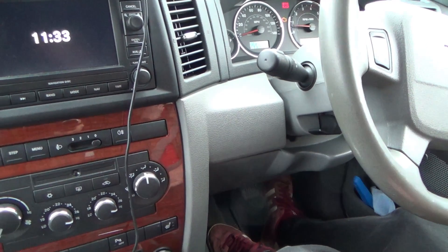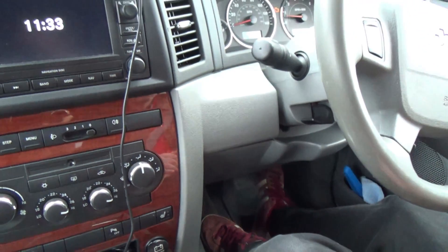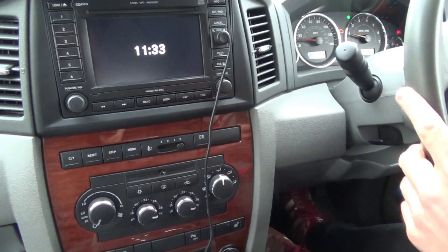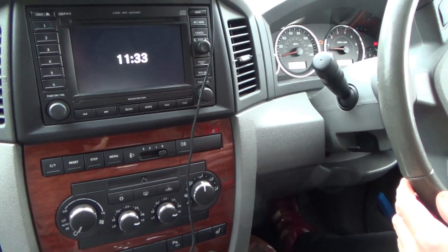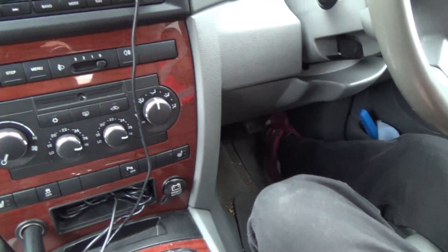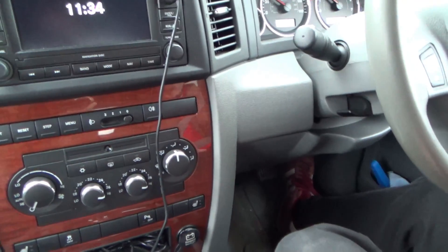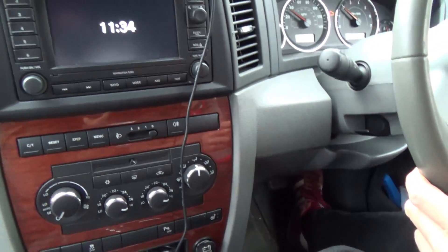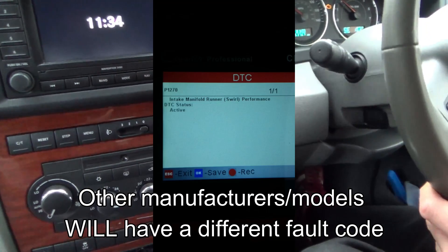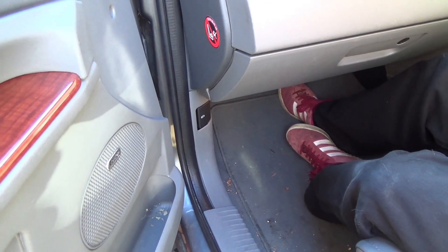This is my brother's car - he's going to drive it now and we're going to do a kickdown. You can see him putting his foot on the accelerator and the car won't kick down. It's limited to 3,000 revs where it stops. It's a 3 litre V6 and it's just lacking power. When we plugged in the diagnostic tester it was coming up with a swirl flap motor fault. Now we're in the UK so this is a right-hand drive car - here's the flap to release the bonnet.